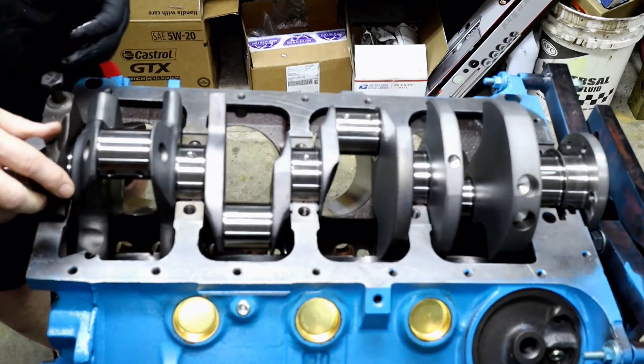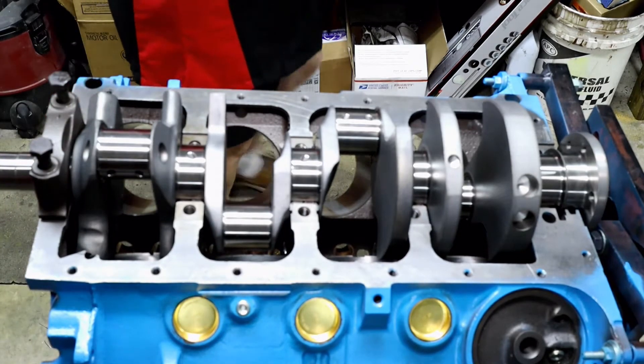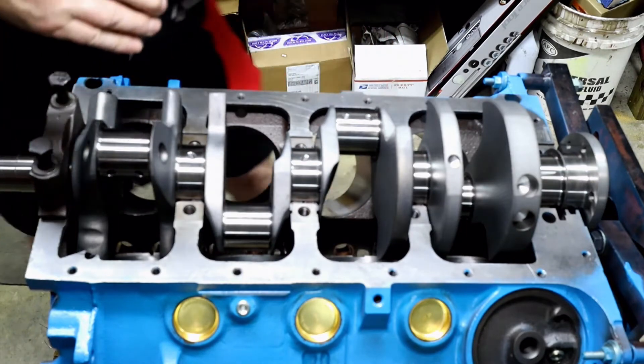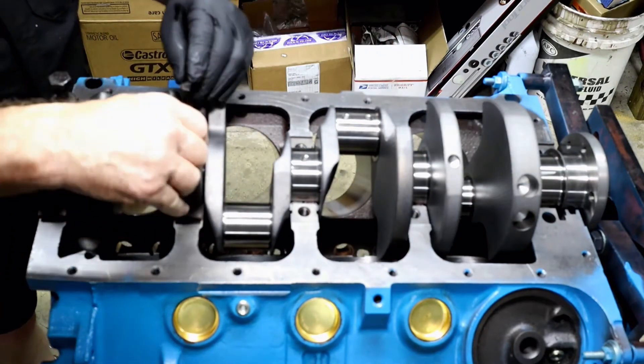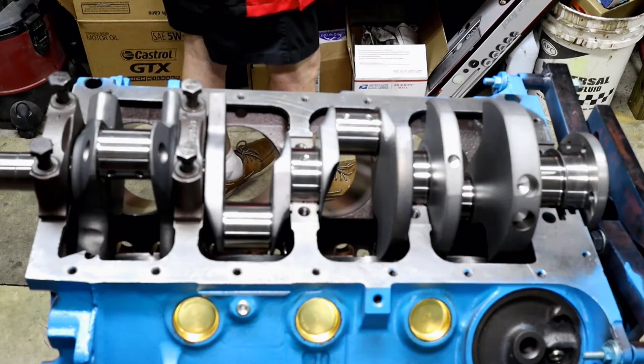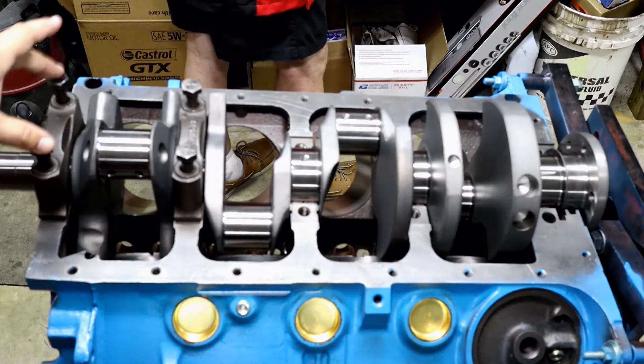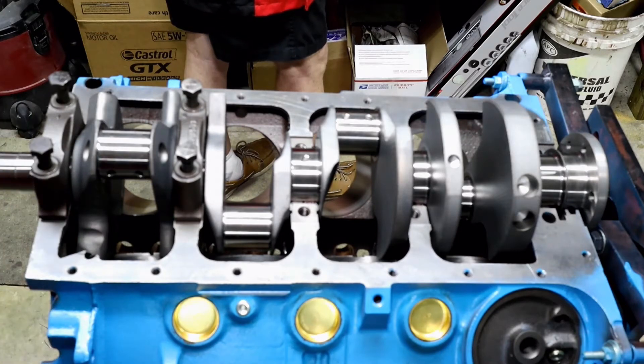What we're doing right now is we're going to go ahead and get them on there. We're going to put the plastic gauge in a little bit later. What we're going to do is an initial set to make sure it spins freely. If it spins freely, great — that tells us that we're in rough alignment. That's our quick eyeball test. After we give it our spin test with everything torqued down to spec, we're going to pull them back off and run our plastic gauge to make sure we're good to go.